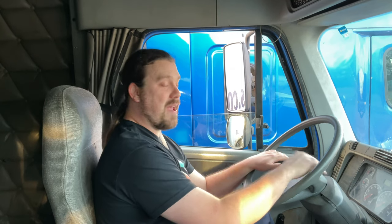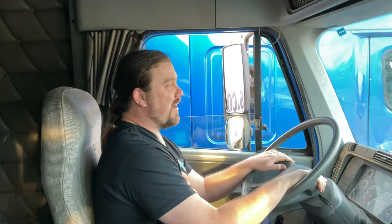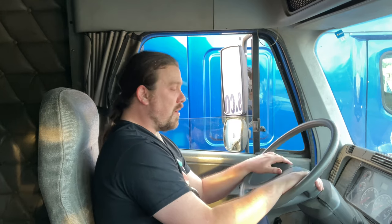Now I'm going to begin to fan my brake pedal. Between 90 and 60 PSI, the low air warning light and buzzer should sound and appear. They must sound and appear before pressure drops below 60 PSI. And of course, they already have. We can hear them going. So I'm going to continue to fan my brake pedal.